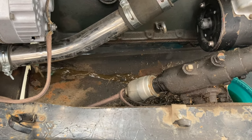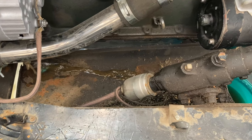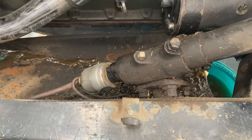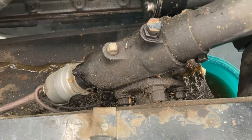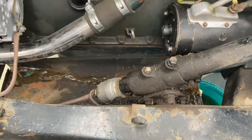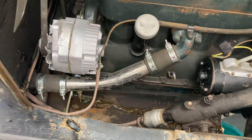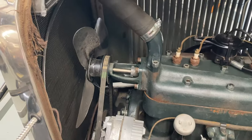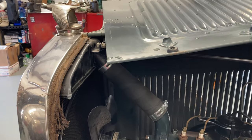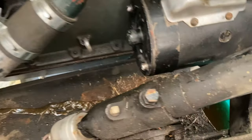Right now there's just water in the radiator that we're draining out — there's no coolant at this point. We will be putting coolant in when we install the new radiator. If you just had to replace something and wanted to drain the coolant to fix it, you can use that coolant over again — that is if it's clean coolant, not looking like this rusty water.